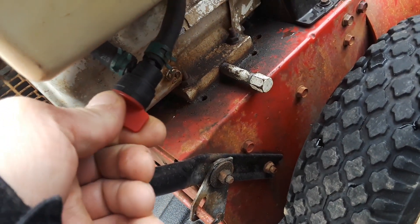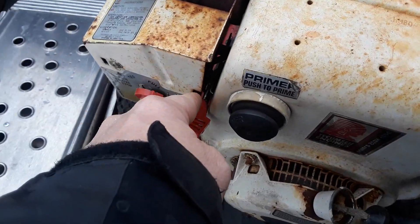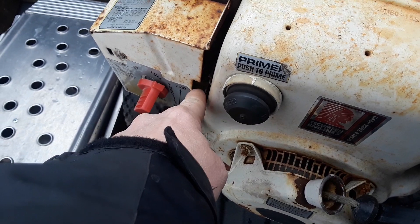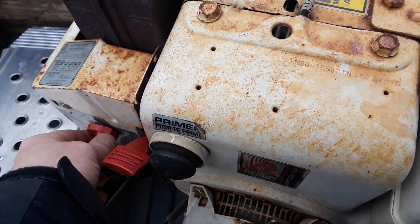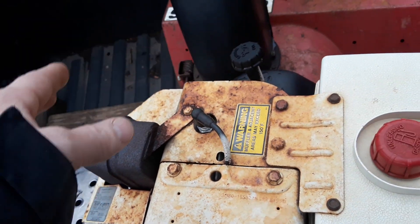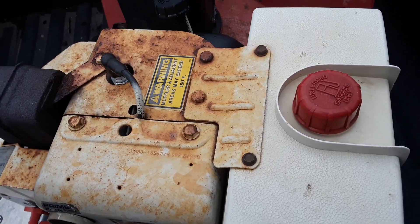Is the fuel shutoff off? Yeah, fuel shutoff is off. It is going a little bit fast still, but that's simply because there's a set screw for the top RPM speed that I'm going to have to adjust. So the high and low RPM speeds are going to need to be adjusted, but it's not running all over the place. Now I can bring it down to here and it'll be at 3,600.